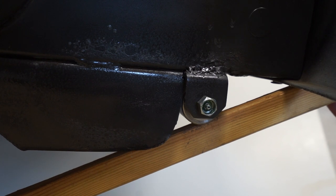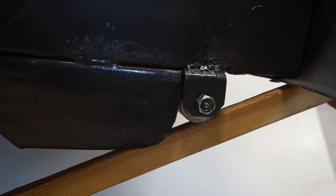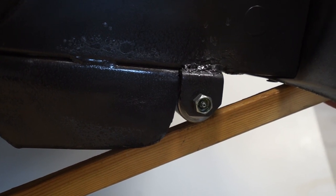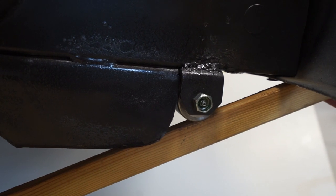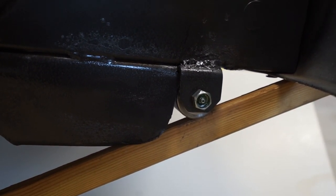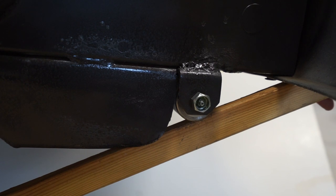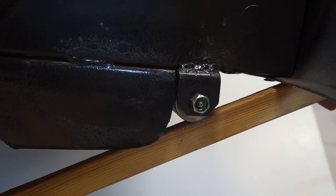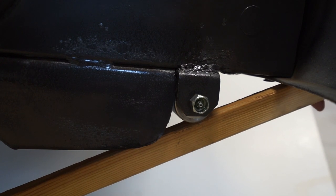This is a finished installation. Notice I put a straight edge here and that the roller will hit at about the same time as the deepest part of the slider would hit. The roller is located about three and a half to three and three quarter inches ahead of the back bumper, and we'll give it a try this winter and see how it works. Might have to put it back just a little bit more if the slider hits too much and digs in.